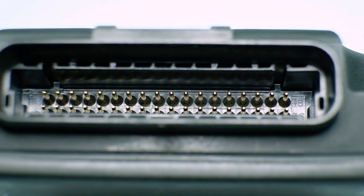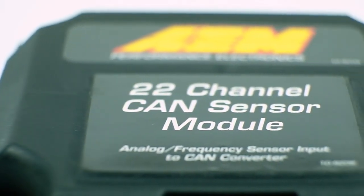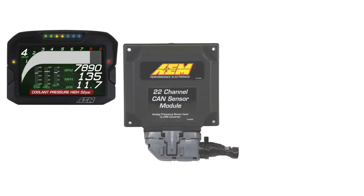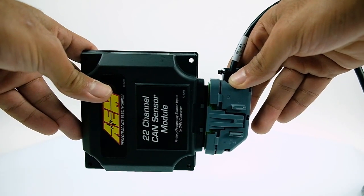With the Starion I've got more to figure out, so what's my solution? This is a larger version — our 22-channel CAN sensor module. Without going into the full list of temperatures and pressures, it brings in a lot of analog zero-to-five volt channels, with selectable zero-to-five and zero-to-16.5 volts, so you can do thermistor or typical analog sensors. It also does RPM and fuel level, giving you 22 channels of data, all coming into a 36-pin Packard connector.